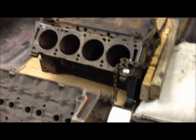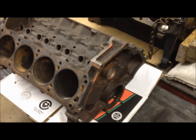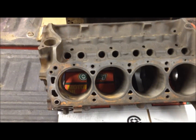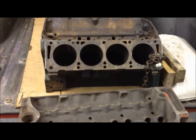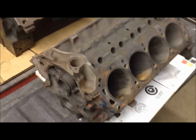The oiling system is slightly different: the FE will go to the camshaft first and then to the rest of the engine. I believe the small block Ford divides it equally. Looking at them side by side, they look fairly similar from the same manufacturer, and even the bores don't look that different despite the FE being a bigger engine.